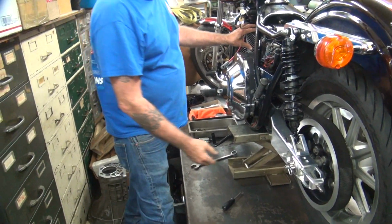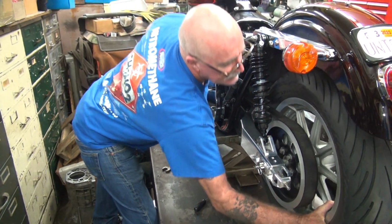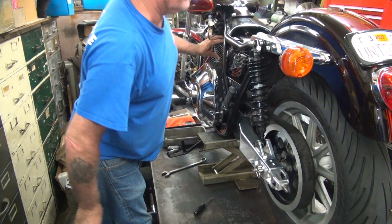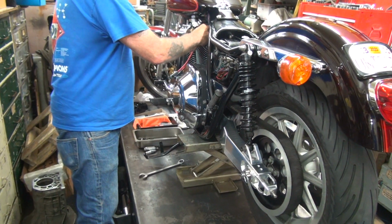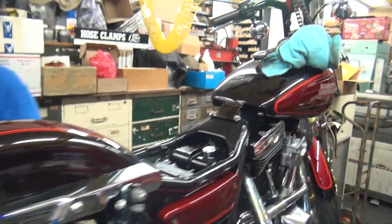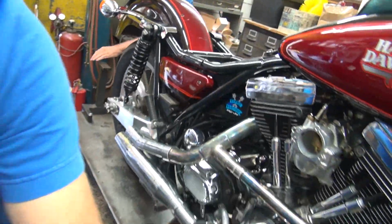If it's sucking, that means the valves are closed. Okay, now it's blowing. Nothing. Okay, put the screwdriver in the hole. Did it hit something? That means it's very close to top center. No suck, no blow means you're close, unless you're on the overlap stroke and the valves are open. Didn't do anything either.